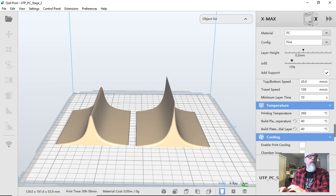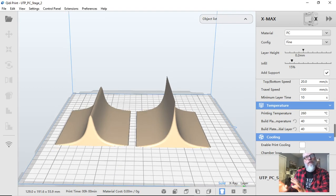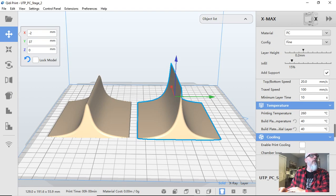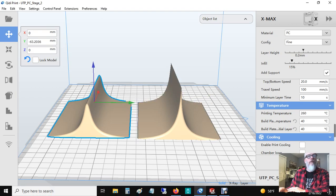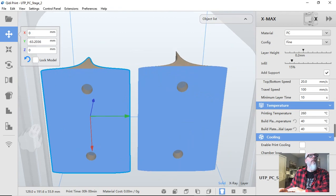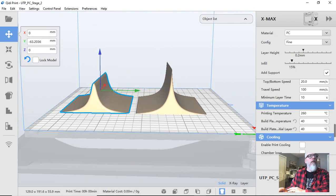At the same time, while still retaining low-speed RPM fill — kind of like the inserts we used to do back in the days of the turtles on the M1 manifold. They were really hard because they were so small; I think if they would have made those a little bit bigger we would have done better with those. So that's our newest offering — the old stage 1 wedge and the stage 2 wedge — and you can obviously switch back and forth between the two. You're just changing your belly pan out and bolting the setup on the bottom. There are still threaded inserts on the bottom and inside of these with quarter-20 bolts, and you lock-tight that to the bottom of your aluminum plate or whatever plate you've got, even if it's a stock one.